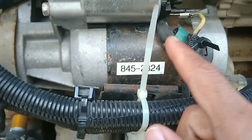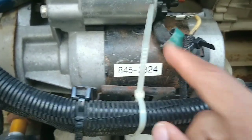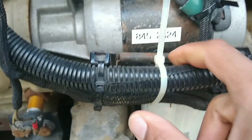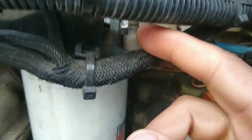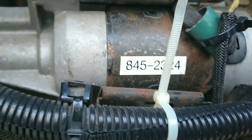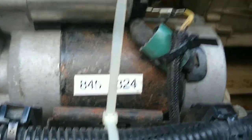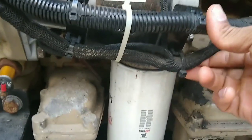Anybody who knows me knows I love wrapping something in garden hose. This little line was kind of laying on this one, and although it's protected, I still used the garden hose. Then I had to zip tie this up. This little bracket — the old starter, this bracket attached to — you can't really see that screw. But anyway, it's a screw that goes through the starter and the bracket attaches to it. It kind of sat up there neat. For some reason it's not in the same spot, so that's down too low — it's going to be in the way of the oil filter. So I tried to bring it up some so when I change the oil I can get to the filter.